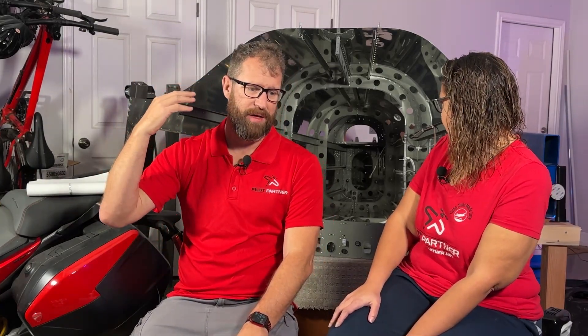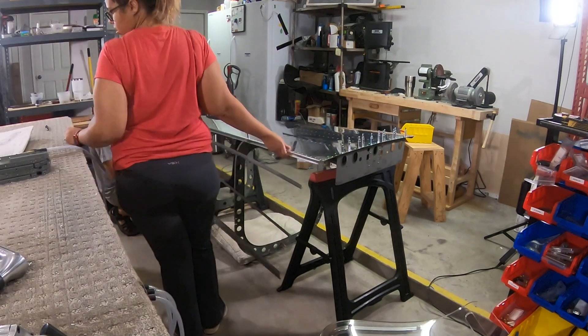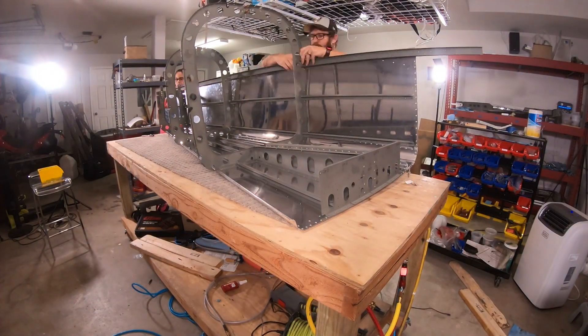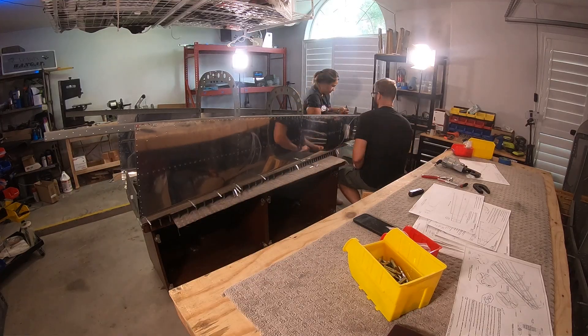A couple of BNC cables routed down both sides with zip ties tightened going all the way back. Then let's talk about riveting the bottom section. When we put the bottom skin on, that was pretty easy. We were doing it upside down — I was lying underneath the sawhorses. Until you get the bottom skin riveted on, Van's tells you to put it on two sawhorses so you can get in between. She is the best rivet bucker we know, so she was down on the ground setting the rivets while I was up top. I had the easy job on that one.